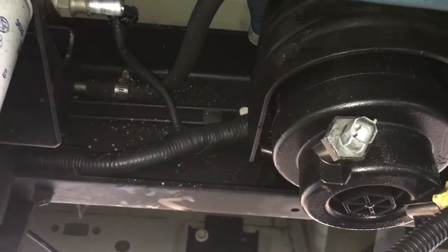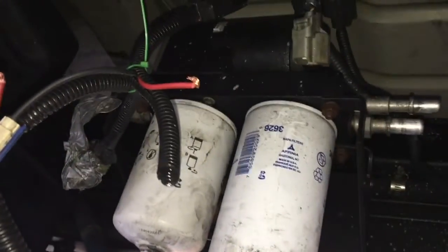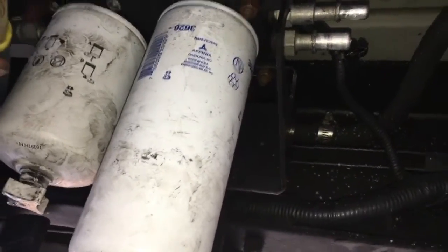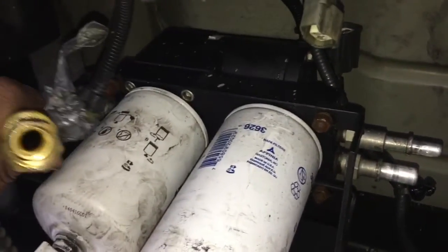Also a note: the factory pump is not strong enough to actually pump everything through the AirDog. So I might need to carry a backup connection so I can feed directly into the factory just in case this happens again. I'll find the fitting — there's a quick-connect fitting that can actually screw into that one. This is my feed line coming from the tank.